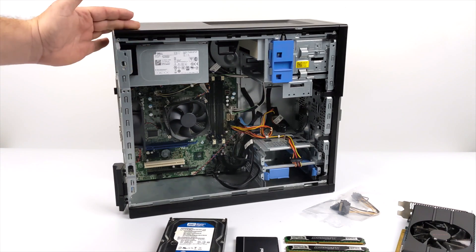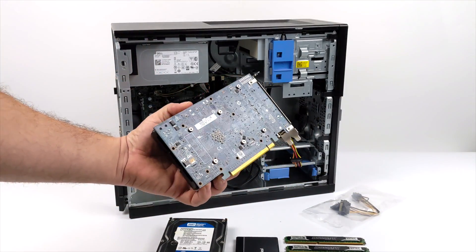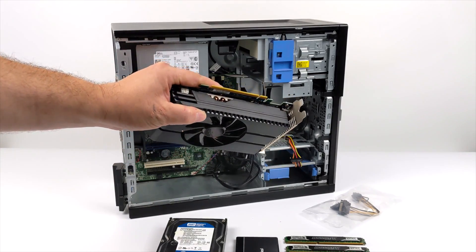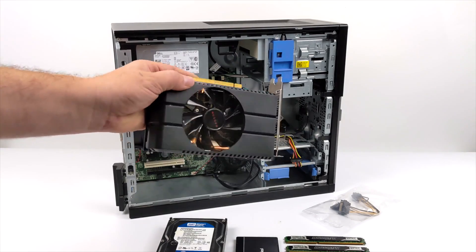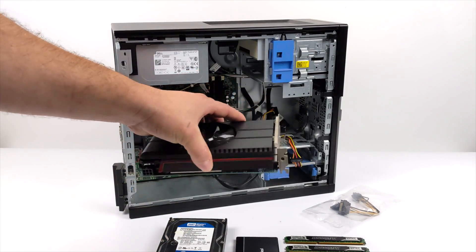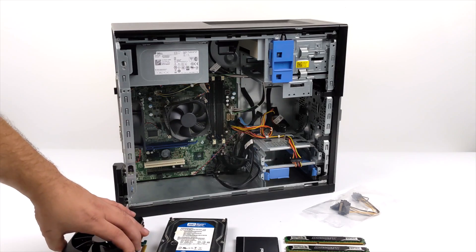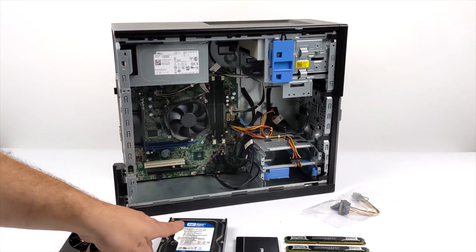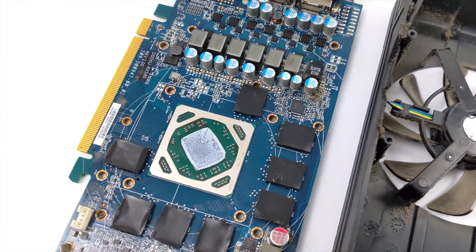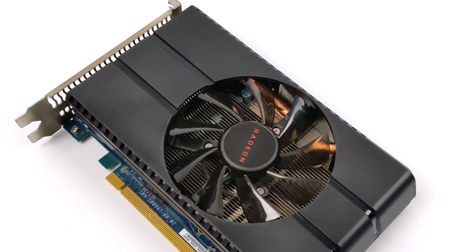Next on the list, we have the graphics card. We all know that it can be hard to come across a graphics card, but I've actually had really good luck in this weird time we're in on my local Craigslist. I would highly recommend checking it out. I found this listed for $165, and the seller stated it was an OEM RX 480, so I offered $145 and was able to get it at that price. When I got home and tested it out, it actually happened to be an RX 580 — the four gigabyte variant. So I did get a little bit of a deal. I did clean this up and replace the thermal paste on it; it was pretty dusty and the thermal paste was dried out. I used some Cooler Master Master Gel that I had laying around, and once that was finished it cleaned up pretty nicely.